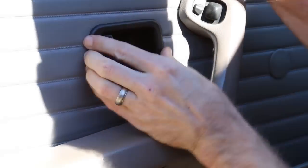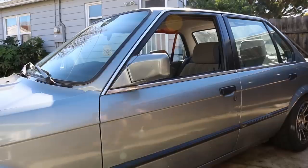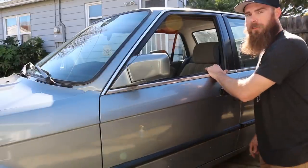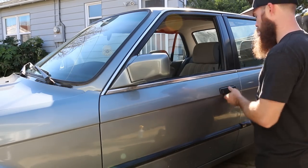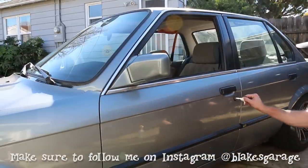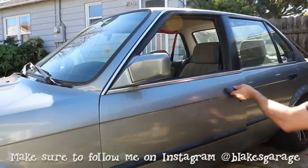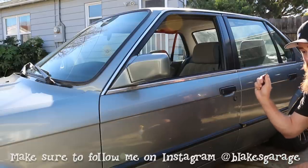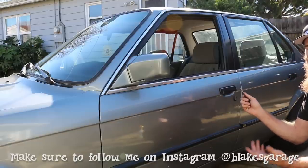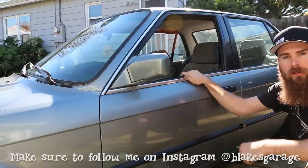Put the two longer screws in the bottom of the armrest and we'll be good to go. When you test this, it's definitely a good idea to keep your window down just in case you lock the door — you want to be able to push down or pull up to unlock it in case it doesn't work. Put the key in, turn it — it's locked. Pull the key out, turn it back up and over — the door's unlocked. Sweet, it works really really good. Before, you literally felt like you were gonna break the key off every time, and that's exactly why the key broke off. Make sure to subscribe, guys — I have a bunch of other modification videos for this car.